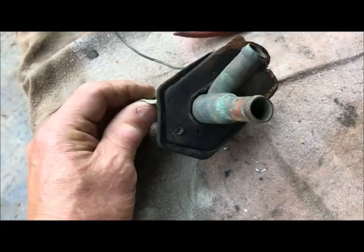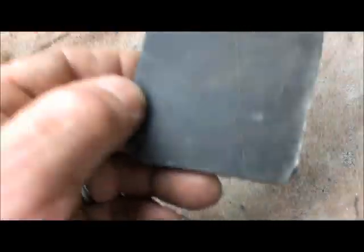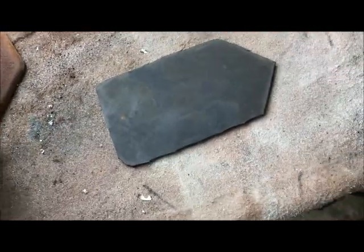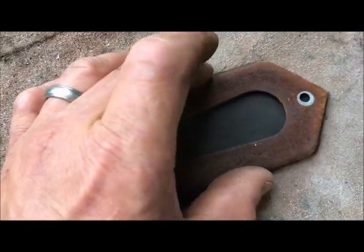Fastest cover ever. I took out the heater control valve and had a metal cover over it. All I had to do was cut a piece of thin rubber sheet — the kind I keep around for gaskets for taillight housings — make a gasket, drill a couple of holes, and that's it. Quick and dirty, but that cover's on.